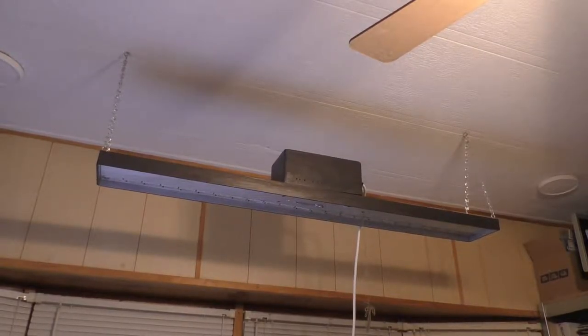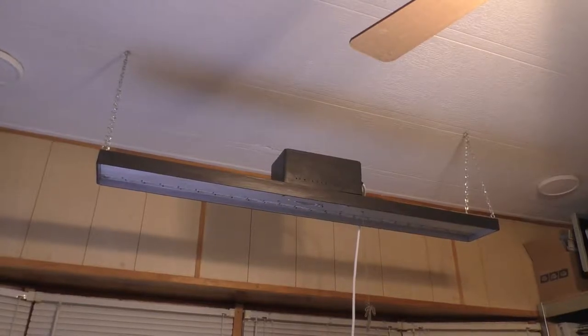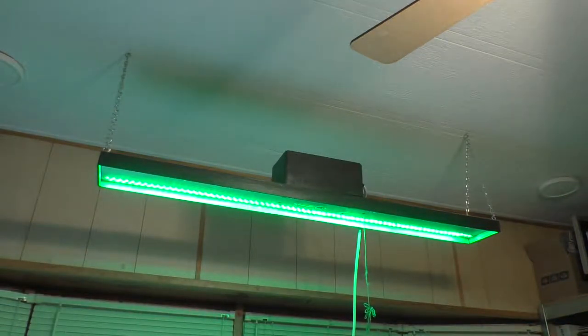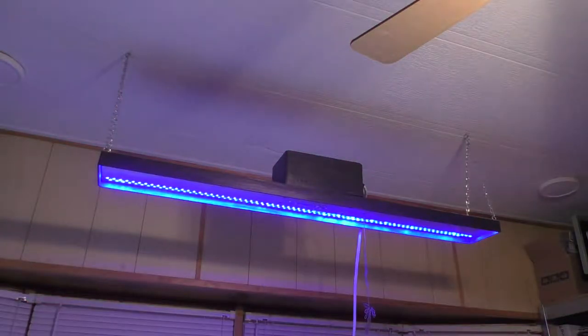Unfortunately, the particular fan I picked doesn't like the lower voltage on that switch, so you have to turn it to the high voltage setting, get it to go high speed, and then turn it to the low voltage setting to keep it spinning. That'll be something I'll have to fix when I get this apart. Now watch — when I turn it on you can see it's red, however if you look at the remote, when I push the red button it turns green. It never had that problem before and I didn't change anything with the wiring. I just turned it on one day and the colors were crossed. I have a feeling it has something to do with the little microcontroller they use in the LED control board, but I'm not sure. If you hit blue it goes blue, if you hit green it turns red, and if you hit red it goes green.